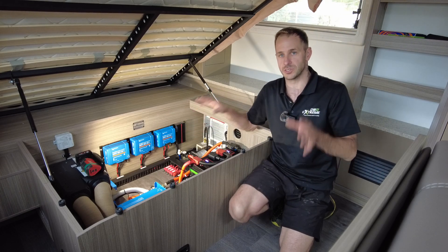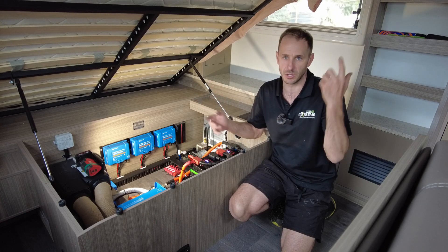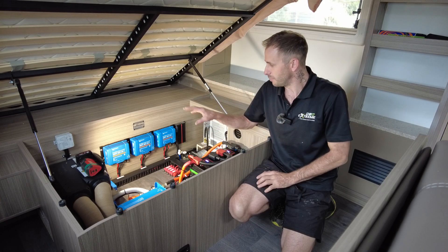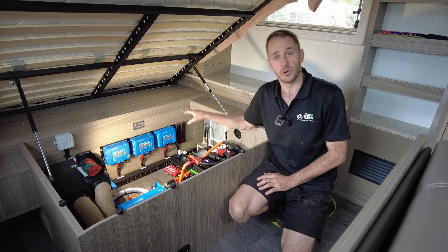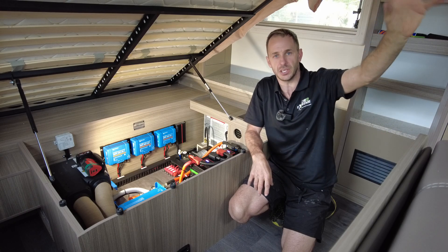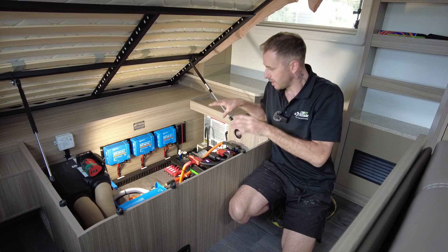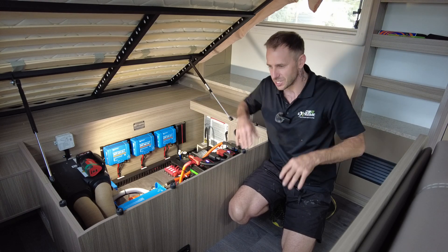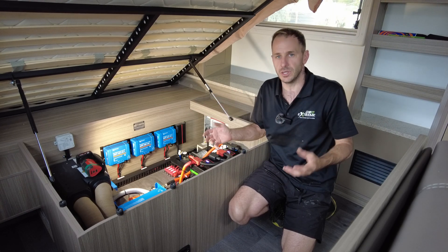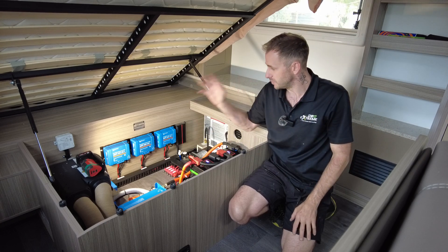The reason for the three solar controllers on this big off-grid setup is to cover not only the massive amount of solar on the roof of this Willow, but to split the arrays on the roof so they run independently to yield more power over the day. If there's any shading issues on the left, right, or even the front, the others will continue to work. They're all networked together — essentially working as one unit but separate. Think of it like a tracking system for each array.